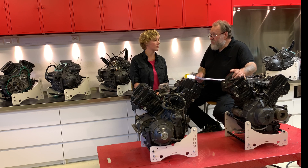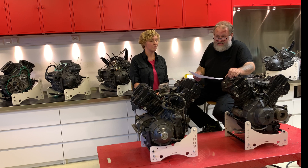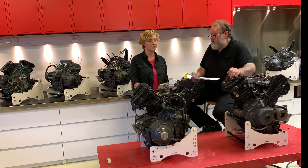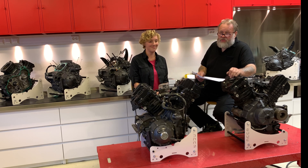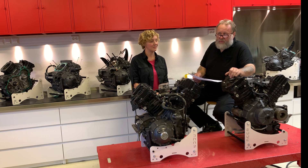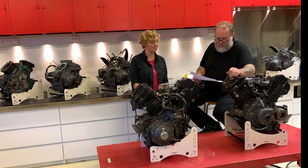For the fuel pump, we will also offer a test run in the package. If you send your fuel pump with the engine, we will put it on our test bath, check the volume and pressure, and we will replace the fuel sensor — because we now have a solution: a German industrial sensor that we think will do the trick. It looks like we have a very good fix.